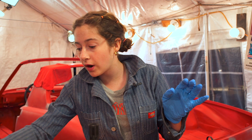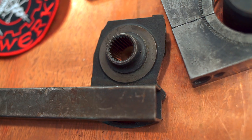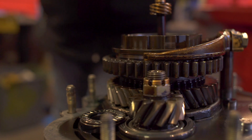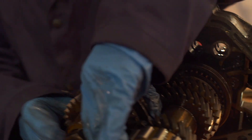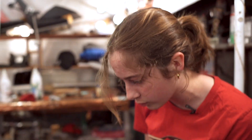I've been getting help from Dr. Evil at Evil Works — he has all these videos and he even sent me some tools. We started out by unscrewing everything, then we took out the gear stack, set it on the table, took off all the gears, and then we had to replace any parts that were worn down. A lot of times it was the synchro band that was worn down.